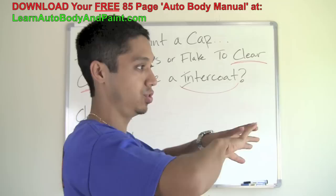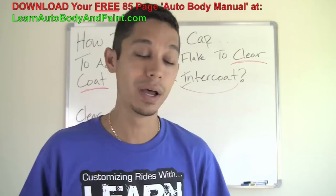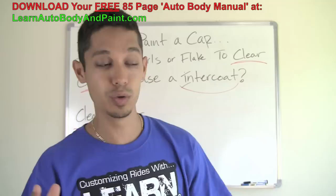And then once you have a uniform cover all over your whole car, which we show you exactly how to do within the VIP members area at LearnAutoBodyAndPaint.com, you mix up some clear coat, just clear coat, and you put 2-3 coats of clear on top of that, and that's that, all right? You have less chances of running.